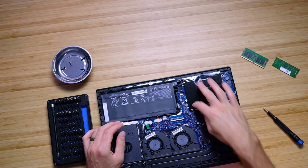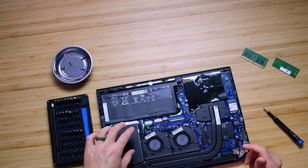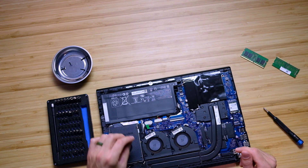You can also do an SSD upgrade by pulling this tape back, pulling out that SSD, and replacing it. Or you can add an SSD here — it's not an M.2, it would be a SATA drive, and you could add that right there to get more storage. That's the cool thing about the HP Pavilion: there's a lot of upgrade options.